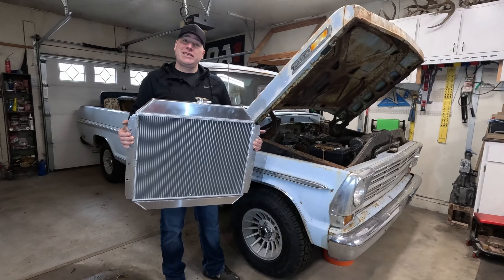If you take the cap off it will help drain a little faster. The next thing I want to go after is the hose clamps on the upper and lower radiator hose — we'll get those detached from the radiator before we take it out. Depending on the age of your hose it might be on there pretty good, so just take some channel locks and twist it back and forth to break it free. I've got new hoses, so it's okay if we end up tearing or needing to cut these hoses to get them off.